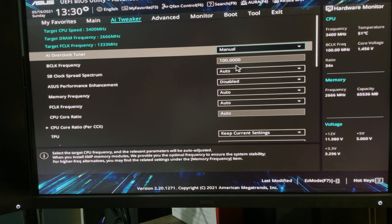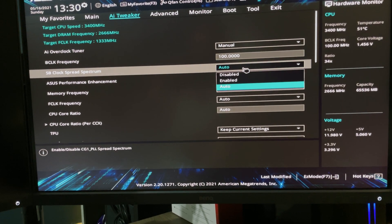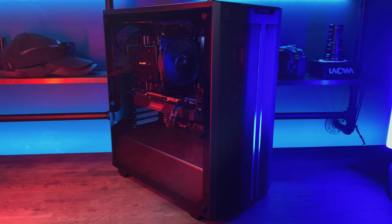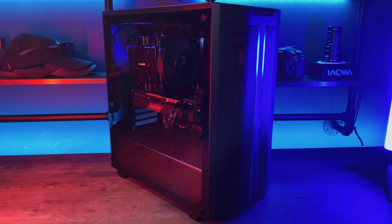It lifts the limits to a reasonable amount where it's not becoming unstable. I don't overclock manually — picking gigahertz and voltage — I don't want to do any of that. But if the motherboard can do it for me and it's still 100% stable, let's give it a go. I gave it a go and lo and behold it worked and it's stable. I now have an all-core boost of around 4.5 GHz. The temperature goes to a maximum of around 85 to 90 degrees, which on this CPU is perfectly okay. It's actually quieter than the old system when it ramped up.